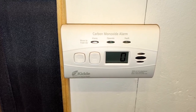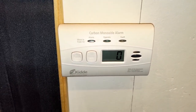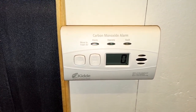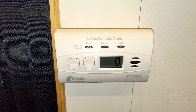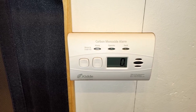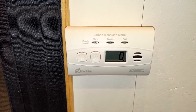This is a carbon monoxide alarm. Running the diesel heater like we do — or if you have a buddy heater or any sort of heat inside your camper, RV, or trailer — it's a good idea to have one of these. If for some reason there's a fault in the exhaust port on the heater and it's kicking carbon monoxide out into the living space, this alarm will go off and warn us. We don't sleep with the diesel heater on — we heat the trailer up before we go to bed, and if it gets really cold at night I'll get up and turn it on to warm the place up.